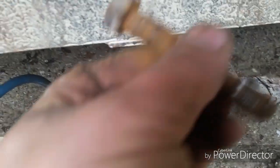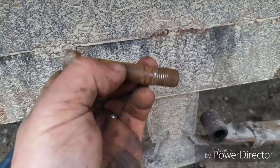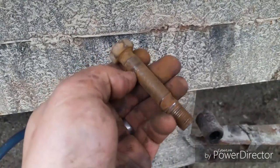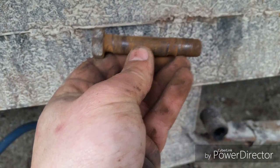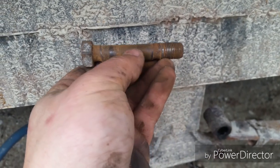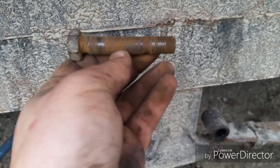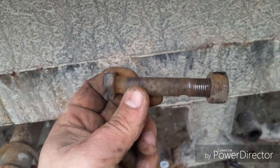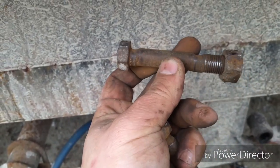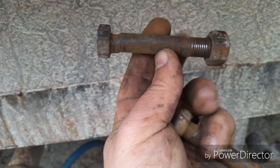So it leaves a lot of wear points. You can see the shackles being egged out like that. There's a bolt that looks a little bit like this — it's worn there, and it's worn back up here. That's your point where your shackles were eating at it. And if you look real close, you can kind of see how it's worn through there — that's where the spring or the compensator was eaten into it. You can see where it's got the same wear pattern, and that's supposed to have teeth in it — you can see how far down that has slid, and where the shackles have been on it.